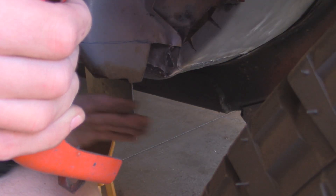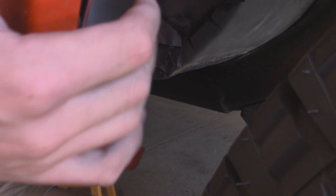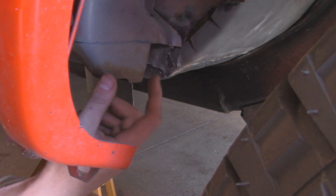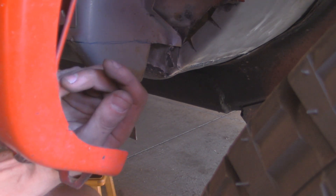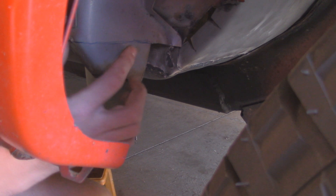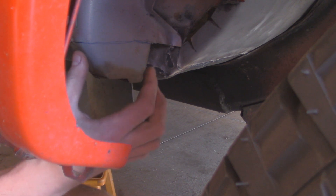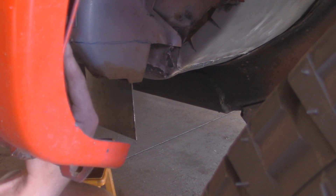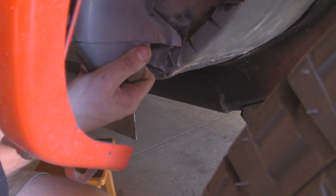Alright, so cutting up front here for the new rocker behind the fender — which is this piece right here. I just have a few bolts out of it because I'm too lazy to take off the whole thing since you have to take off the front clip. So I just got it kind of pulled out of the way for now so that way we can fit an angle grinder in here. And cut this last bit that's right here — I made this pretty much flush to where I've cut it on the side of the rocker, so that way when we slap this up it's going to be nice and flush and we should be able to weld to this line right here. I did once again make it a little bit longer so that way I don't accidentally cut too much. I can just take a flap disc and keep grinding it down until it sits in there perfectly. Now I'm going to cut this little piece right here and then that's pretty much everything that's any obstruction preventing the rocker panel from fitting in here nicely.